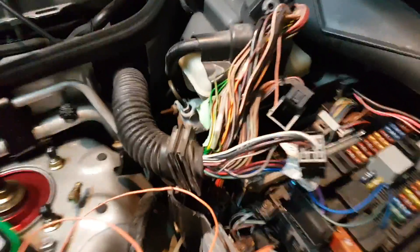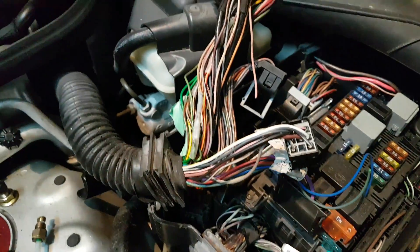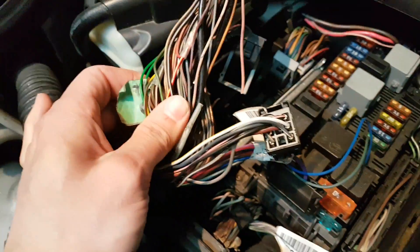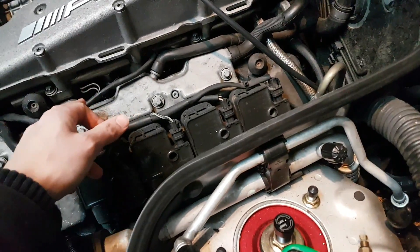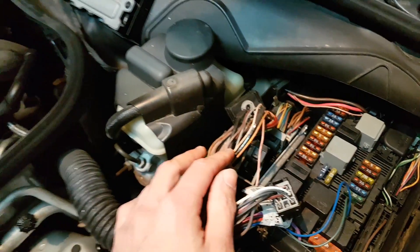For most cars you'll be able to find a wiring diagram online to locate which wire controls what. But the problem for this car is I couldn't find any wiring diagrams or even color codes online, so I had to trace all these wires myself. I've already traced the crank position sensor and cam position sensor by looking up the wire colors coming from them and tracing them back to the connector. But the injector colors are really weird and I can't find them, so I'll use my multimeter with a continuity tester — put one probe in the injector and trace it back to the connector. If I find that pin, I'll be able to identify the wire and connect it to my FIC.